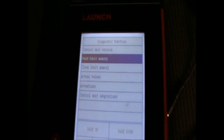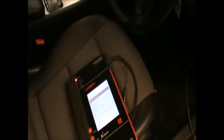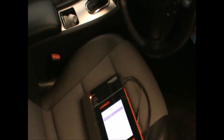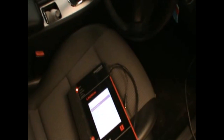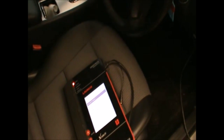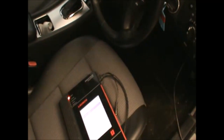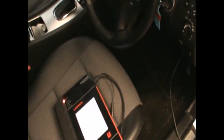Okay, so that's a shame. It's a shame I haven't got the fault codes to show you, but it basically said there's a lean mixture, which was probably related to that crack on that pipe, because it was allowing more air to go in and so on. But anyway, that's how you would go ahead and replace it.